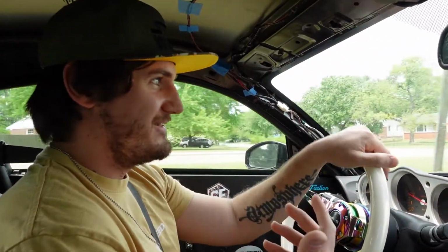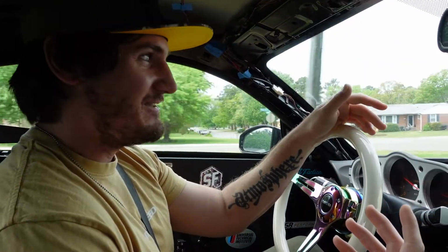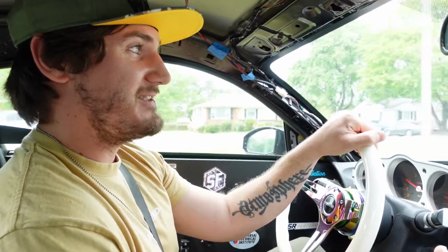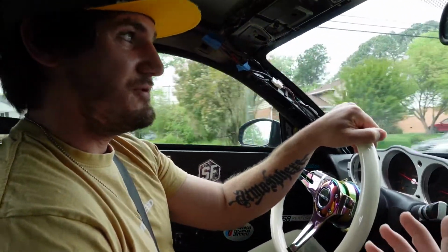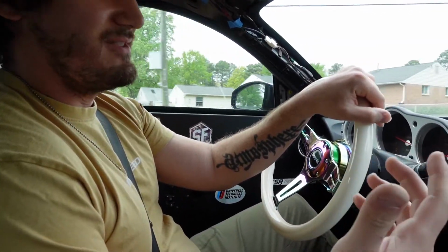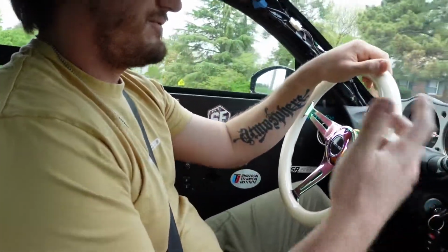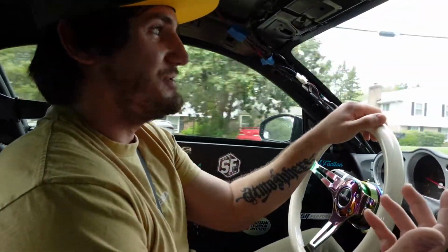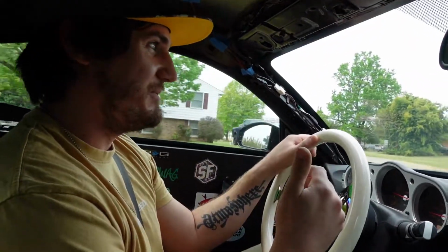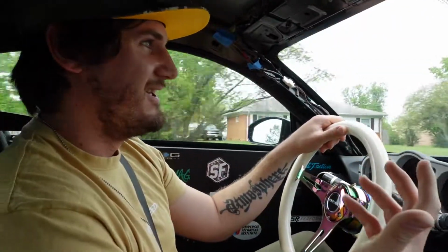So we've been driving the car around, and the shifts honestly feel kind of the same as they did, because I didn't really have a problem with my synchronizers before. The one thing I did look up in the 350Z manual is that the actual capacity of the transmission is 3 1/4 US quarts. And as y'all saw, I only had 3 quarts, so it wasn't really an issue with the fluid being in the pump or being lost from changing the bottles. You actually do need that 1/4 of a quart more to fill the transmission up enough to get it to flow out of the fill hole. So unfortunately you do need 4 bottles, and you'll just have a bottle that you only use that little bit if you want to get it all the way full.